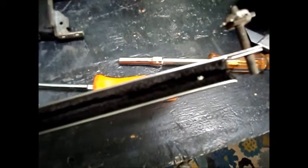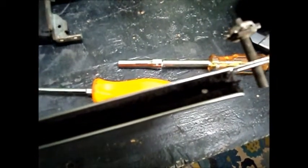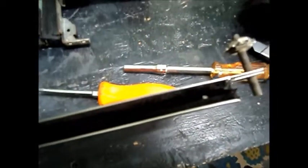Okay, I've used a little countersunk number 6 screw to hold that new felt in this channel. There's my wing vent, and these two pieces will go together like that right there. But right now I'm putting this felt in this channel. I've already got my wing vent seal on here and here, and I want something that's not going to get in the way of the window.